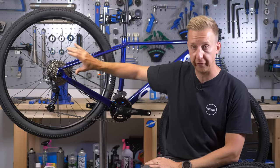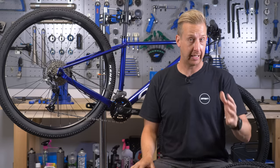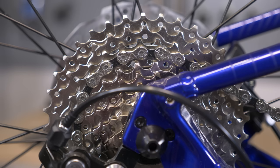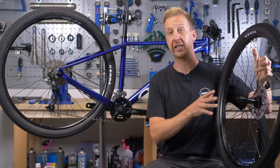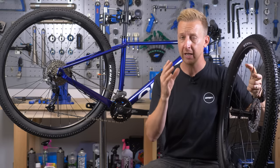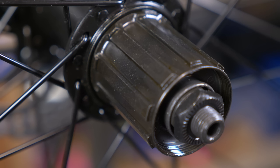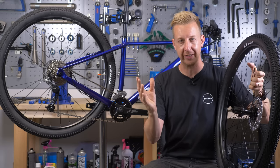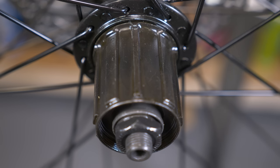What about your rear wheel and how the cassette fits it? On top of the four different rear widths, you've got different mounting systems. Unless your bike is particularly old, you're likely to have nine speed or above. With Shimano's spline system — still pretty much the market leader — eight, nine, and ten speed all fit on the same spline bodies. Most of the time you can also get an 11-speed to fit on there too. Shimano once produced a 10-speed version exclusive to 10-speed, but most of the time you can fit an 11-speed.